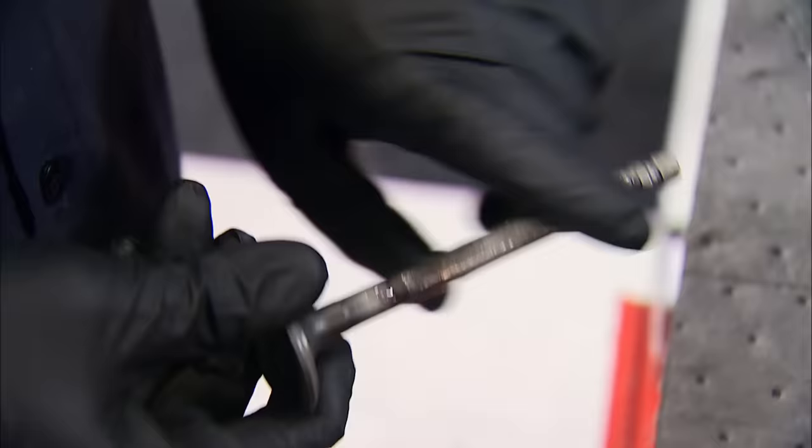That thing's just wicked sounding. First pull: 297 horsepower, 200 foot-pounds of torque — pretty accurate and really consistent, smooth as glass. The engine is a little lean in the upper RPM range. This carb doesn't have secondary jets, so here's how we'll correct it: using a 59-thousandths bit, drill the main metering plate holes to allow more fuel in for a richer air-fuel ratio.